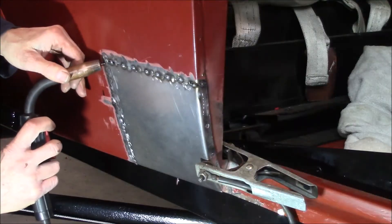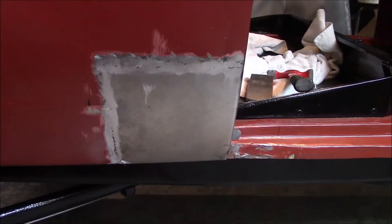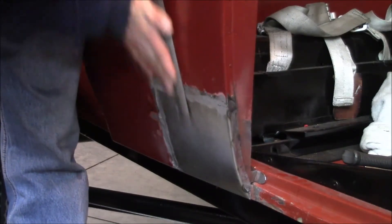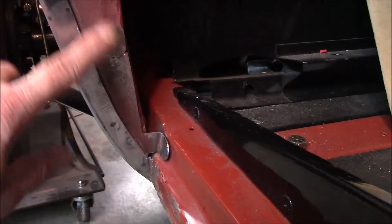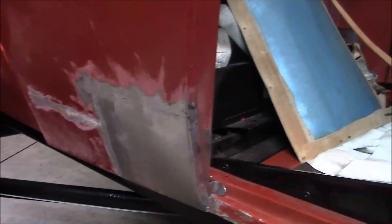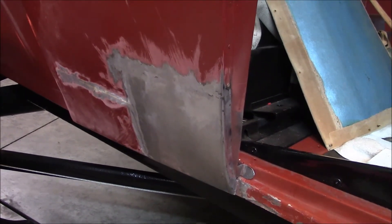Well, there she is welded in. Now I need to try to file some of those welds down a little smoother and maybe a little more hammer and dolly work. There it is, pretty much done. Looks a lot better in this area instead of having that old scraggly weld crap. Got the inside of the B pillar with a tab, and then the outside that matches the original quarter. Came out pretty good — there's a couple little low spots and all that, but body work is not easy to get it right. I'm getting a little bit better, but man, it's tough to get it right. But anyway, thanks for watching.